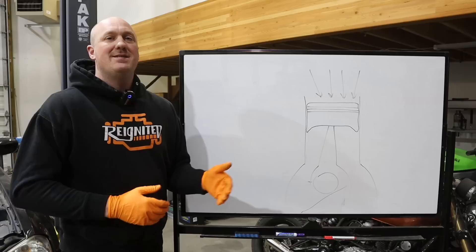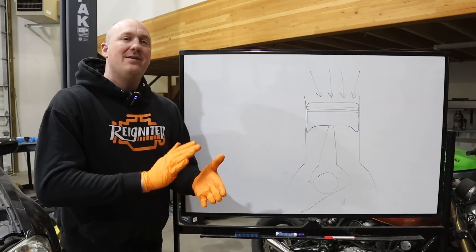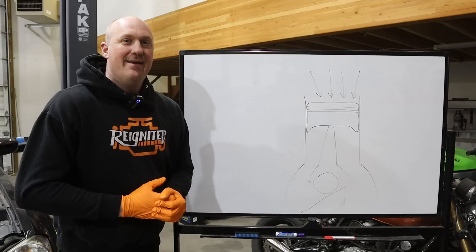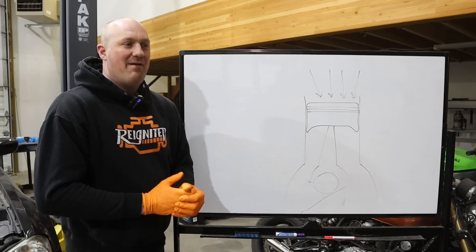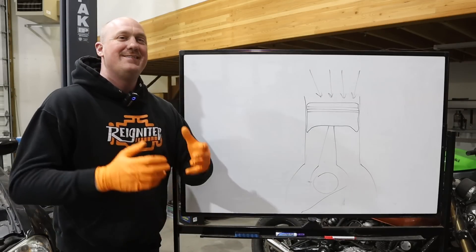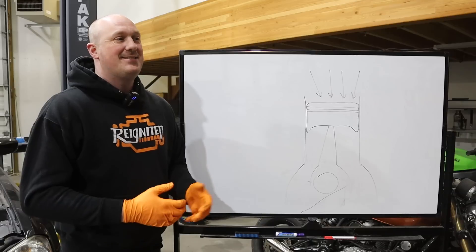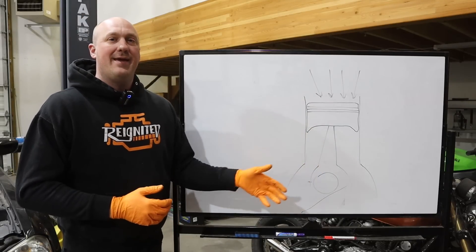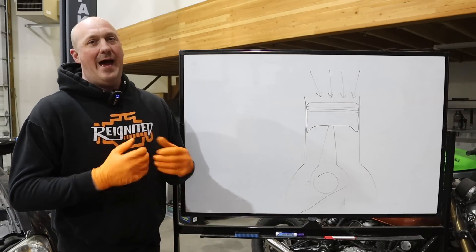There's a funny story about that. Back when I was 17 years old, I moved down to San Diego with my older brother — just our cars and whatever we had in them. The very first day I drove into San Diego, my PCV valve plugged up on my 1988 Nissan Pathfinder and it blew out the dipstick and the valve cover gasket and poured oil over my engine. I'm in a brand new city, don't know anybody, and my car is smoking out the entire freeway because I've got oil all over the headers. It plugged up the ventilation system and the pressure overcame the seals and puked oil everywhere. It was a terrible experience.